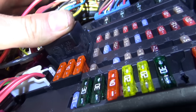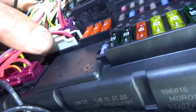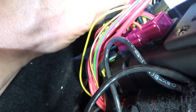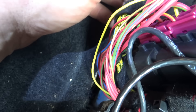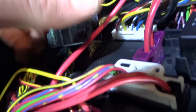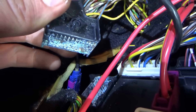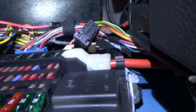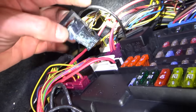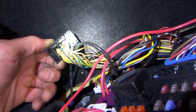So this relay is burning hot. It has codes for the wipers. This is a mess down here. We're going to unplug this connector just to do a visual inspection on it. Oh boy. We're done. That's a shame. The water did its damage. We can still get this thing running, no problem, but it's going to need a new junction box, programming, connectors, and wiring — it's toast.